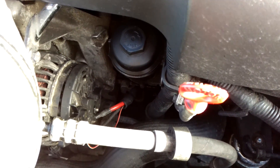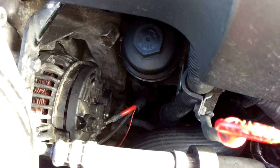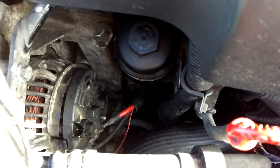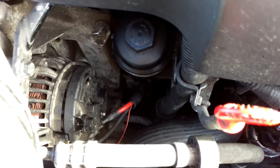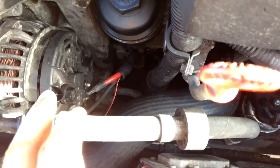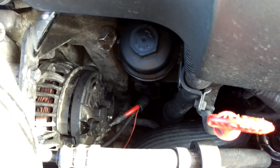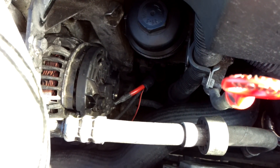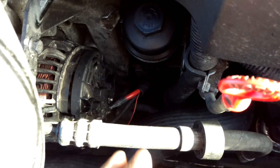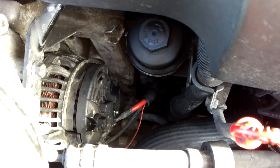This is part three of the alternator testing series and we're going to be dealing with the regulator today. Voltage regulation on much newer cars is actually taken care of in a lot of cases by the engine computer, and on a lot of older cars it's an external voltage regulator. What I'm going to be dealing with today is a voltage regulator classed as internally regulated, so the voltage regulator lives in there. On this alternator it's combined with the brush pack, which is what you'll find on literally millions of cars all around the world.